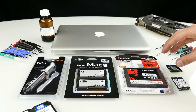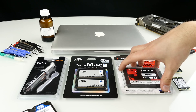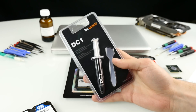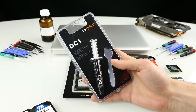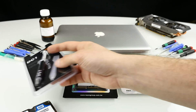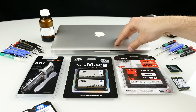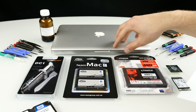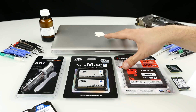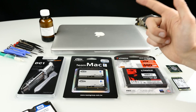So that covers the components: CPU, graphics processing unit, RAM, and the hard drive. My MacBook also runs a little hot and there's definitely dust inside, so I should clean it. I'm also going to replace the thermal grease — this is usually not strictly needed, but I have to take it apart anyway. For cleaning I'll also need isopropanol, which is basically just alcohol.